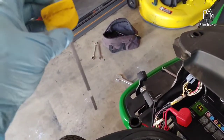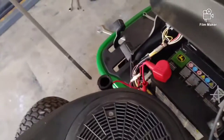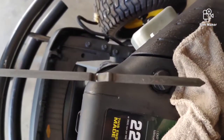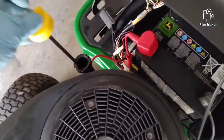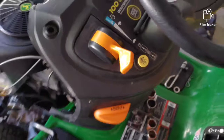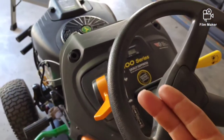I've put about two and three-quarters quarts of motor oil in here. I haven't cranked it up yet to fill up the oil filter. The correct way to check the oil on these units is to let the dipstick go all the way down, twist it on, let it fall down. You can see I'm above the full mark — I've done that on purpose because the larger oil filter will require a little bit of oil. I'm going to go ahead and crank it up with the parking brake on to fill up that oil filter, then check the level.